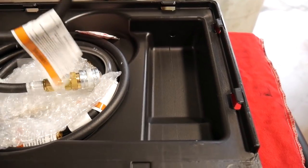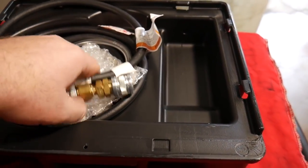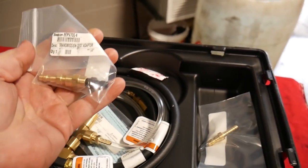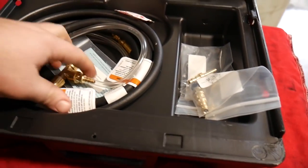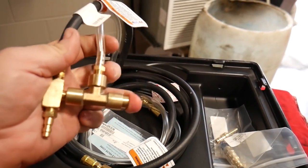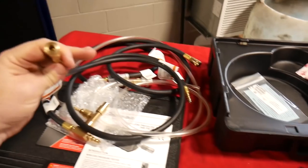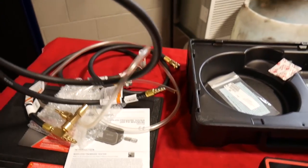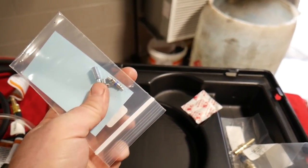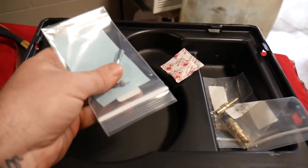So just as the kit comes, we've got an adapter for a compression gauge with a button to blow off the compression gases. We've got a couple of extra fittings that would be for vacuum lines, oil pressure lines, and then this one is for fuel pressure — your standard fuel pressure leads will hook right up to this one. It has the blow-off area right there. There's another adapter in here, an extension for the adapters, and some new ends for the compression gauge pins.